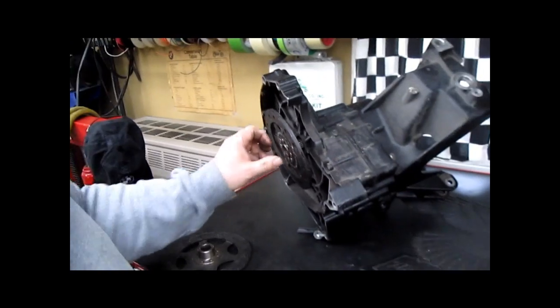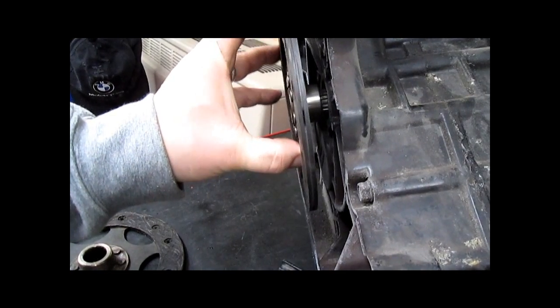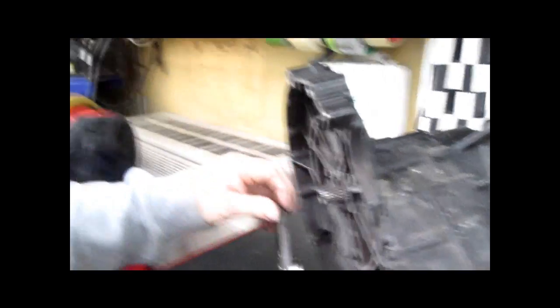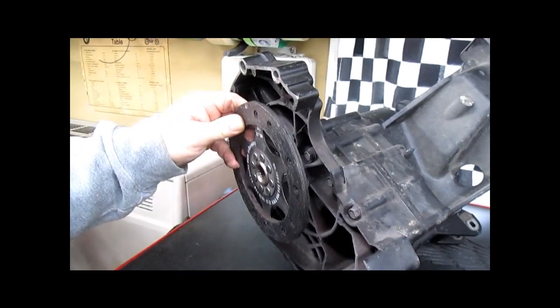What happens is people are lumbering down the road at low RPM. These things surge — this is actually racking back and forth, tearing the splines apart. That's why most of the bikes that have stripped shafts are actually the ones that are gently ridden. They don't hit redline much, they're not beaten on. The GS bikes that are off-road and flogged constantly — their shafts don't strip because they're under load constantly. It's the loaded, unloaded, loaded, unloaded cycling that racks the disc back and forth on the shaft. That is what's causing these failures, besides the fact that it's just a shitty design flaw.